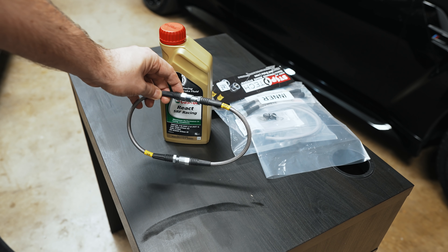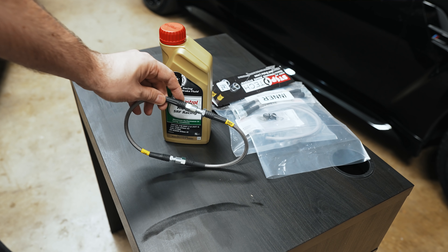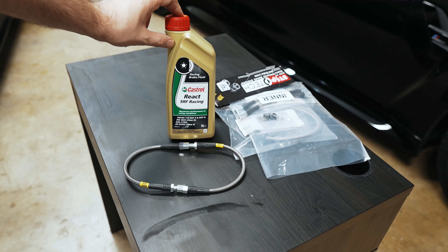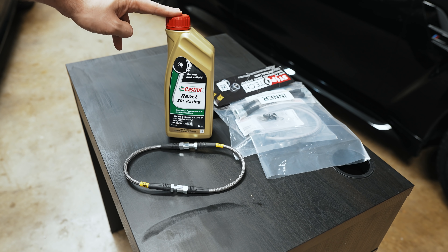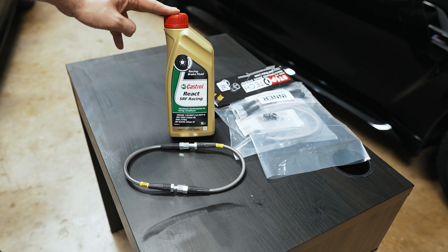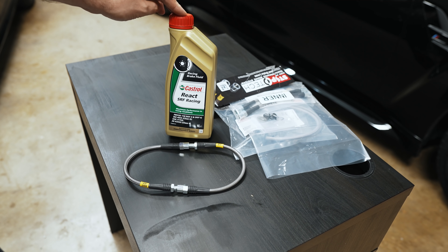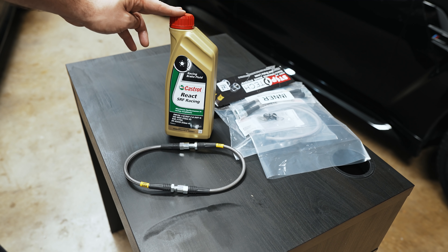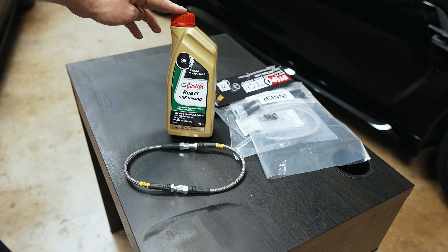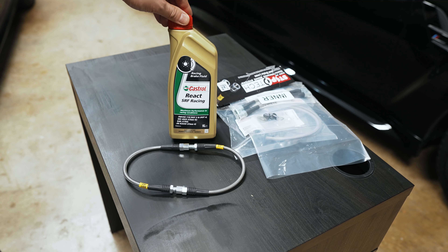During day-to-day driving I'm not expecting this to make much of a difference in pedal feel, but I'll definitely let you guys know after a quick test drive. The main benefit is going to be upgrading to a racing fluid — it's about $70 for a liter to flush your entire car. If you're a BMW owner that has pushed the limits and the engine's making almost twice the power, or even just 50 to 75 percent more power, then your brakes can be an issue if you're really hammering on the car — probably on a racetrack or at the drag strip. If someone's coming up in front of you and you have to scrub speed on stock brakes when you're going a lot faster than the car was ever intended to, you may want better fluid.